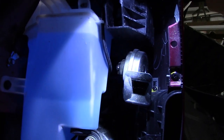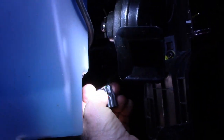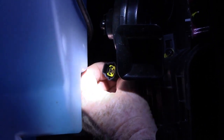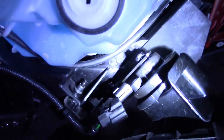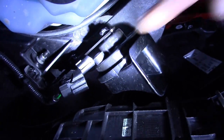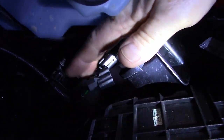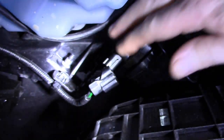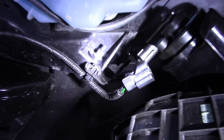This is the original horn. It's held in place by a single bolt, but it also has a connector that comes off — you just squeeze, mash the detent on it, and pull straight off, and your horn should be ready to come loose. This is right under the car, facing straight up into the fender well. Front of the car is that direction; this is the outboard side of the passenger side. I've already got the connector disconnected — there's a squeeze and it removes. Now I'm going to take my needle-nose pliers to get this down to where I can work with it.